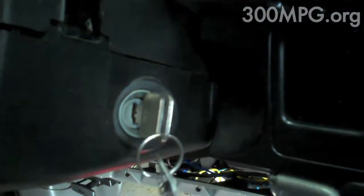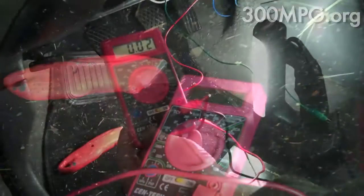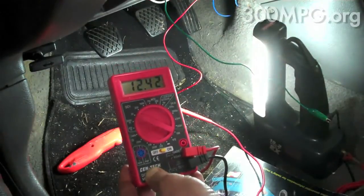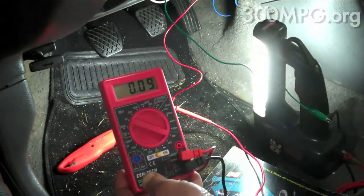So if we look at the key here, I put this in and turn it to on — you can hear the main contactor click shut, so now the electric car mode is ready to go. But if I turn it to start, nothing happens because there is no starter on this car. Following my Haynes repair manual, I looked to see where the wire from the start position is — it's this red and yellow wire — and I double-checked that with my multimeter. So now I've got some jumpers going up to the key crank wire, the other one to ground, and I get 12 volts — in this case 12.42, the resting voltage of the cold battery — and when I let go, it's back off.